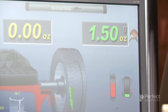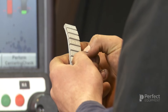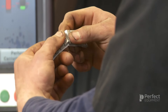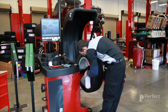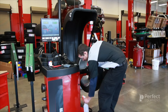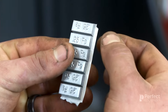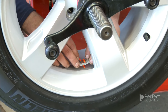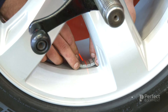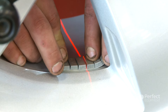If you have decided to use adhesive weights to balance the wheel, you can begin by counting the segments on a strip of weights or on a roll of weights to reach the amount of imbalance. Once complete, simply rip the weight segments apart to achieve the desired weight mass. Prior to installing the weight, you must clean and dry the intended installation area to ensure that the tape will adhere properly. Once clean, simply remove the paper backing on the adhesive weight by pulling down on the quick tab overhang. Grasp the weight in your fingers and properly install it by placing the exact center of the adhesive strip at the exact point of the imbalance, then firmly press down on the adhesive weight, working it from the center out to each end.